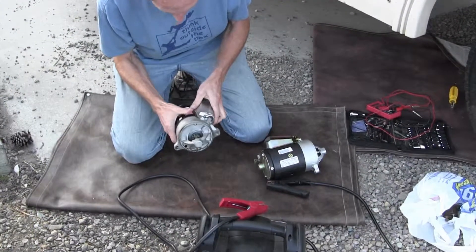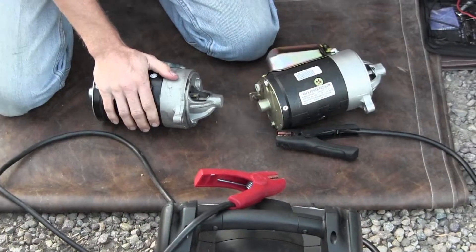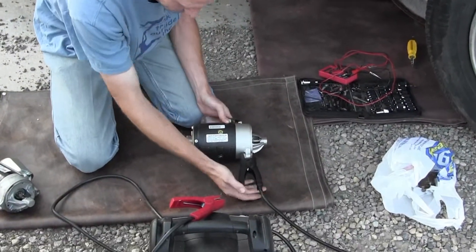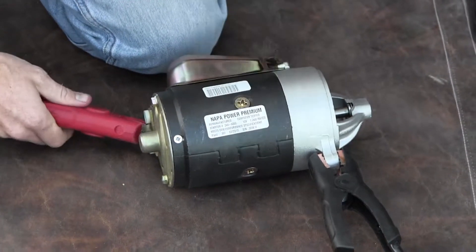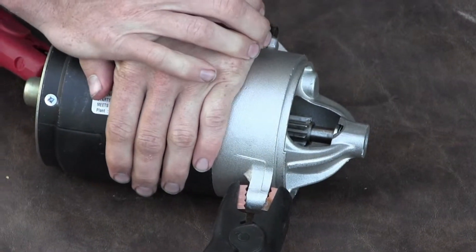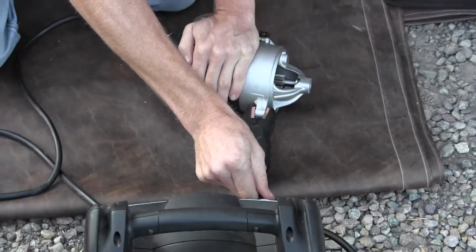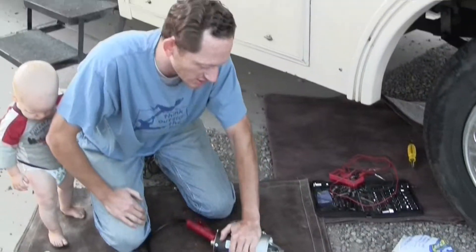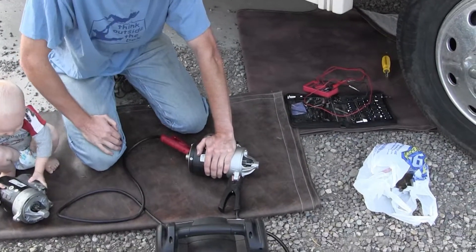So this is the old starter — I've gone and got a new one. I had it grounded and connected the hot wire, then flicked the battery on. I just tried it again — this one is totally dead, not working. This is my brand new one. I wanted to show what it's supposed to look like. If I connect it to ground — that's the one that connects to the engine — and then take the positive hot wire and make sure I've got a good connection... right here is a little crank. When it turns on, it pops out, which then turns the engine over. As soon as you let go of the key, it pops back in and the engine can just run. That's what a starter is supposed to do.